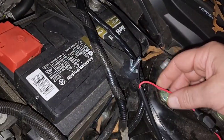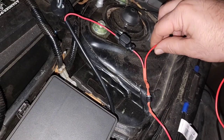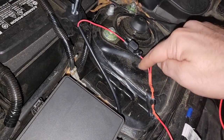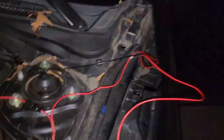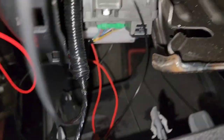The LED controller for the underglow is grounded straight to the battery. The alternate power source from the accessory is connected on this side of the diode — so there's no back-feeding. It only allows current to go one way, but this current will come in this way and go back out. This one goes down into the passenger compartment and connects up to my switch.